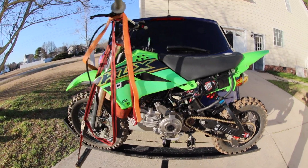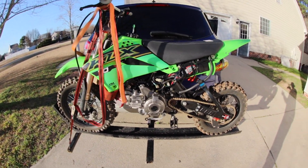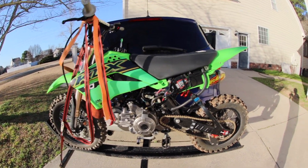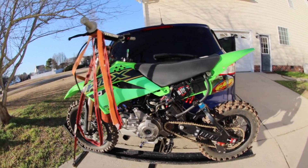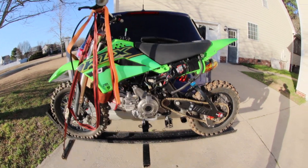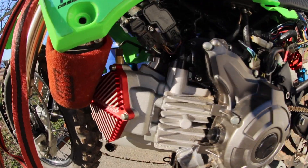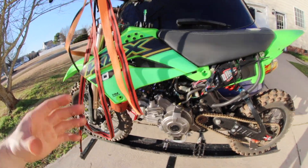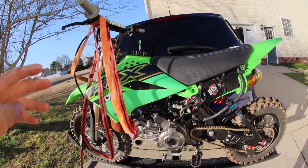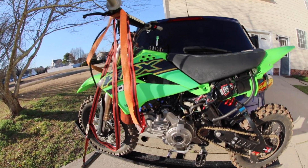Most importantly, I added a V2 head. It didn't feel that good before after I rode it a couple times — I didn't show that in the last video — but after it idled and I worked out some kinks, took it for some spins and it just felt corked or like bottled up. I just wasn't able to get the performance out of it that I expected. It was definitely slower than my Honda with a 132 kit. So we did a V2 head, and then I did a Composimo billet adapter flange — that little plate in there — so that you can angle the throttle body forward. This is all still for Z125 stuff, so I still wasn't able to use the bigger port intake manifold that came with the V2 head.